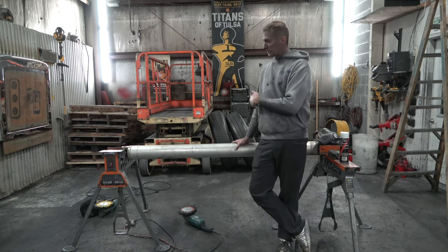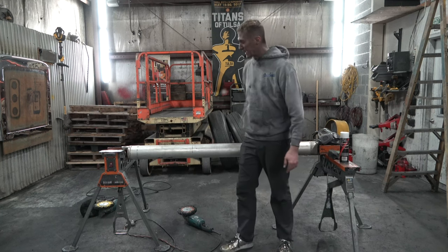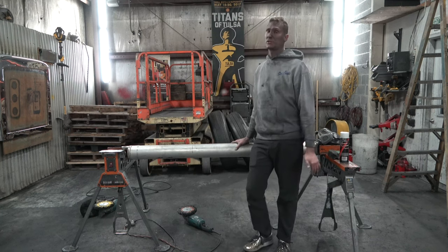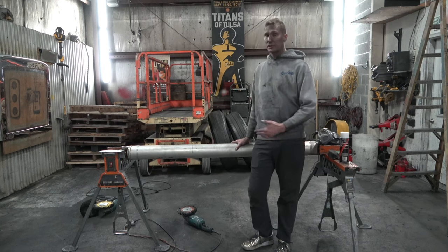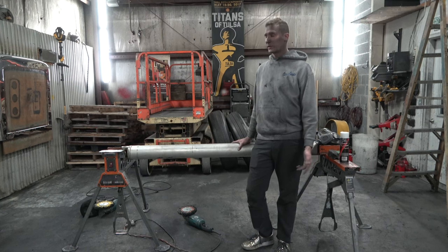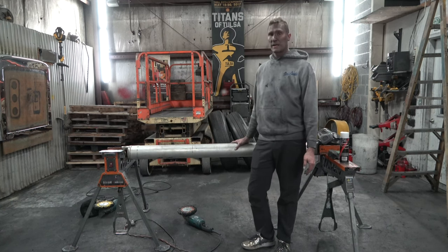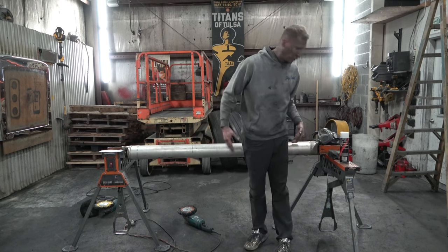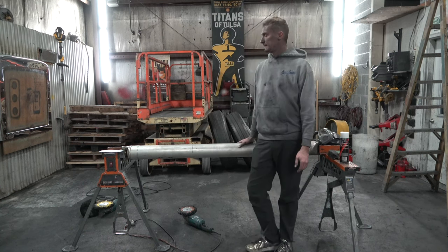So I will cut the entire thing with orange and brown in small sections and then I'm gonna walk end to end because I don't wanna work just those small sections. So really pay attention closely to that. It'll actually kinda go pretty quick. These drive shafts that are in good shape polish relatively quickly. So pay attention to that, watch the small sections, and then I'll widen it out into full length on the shaft.